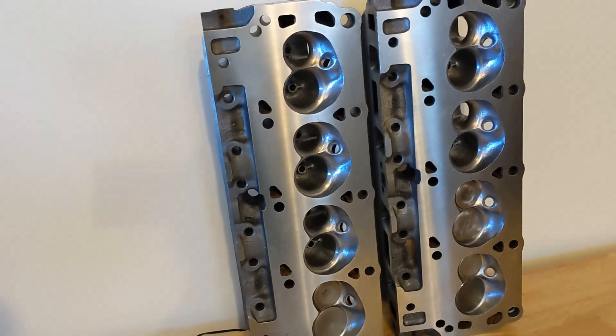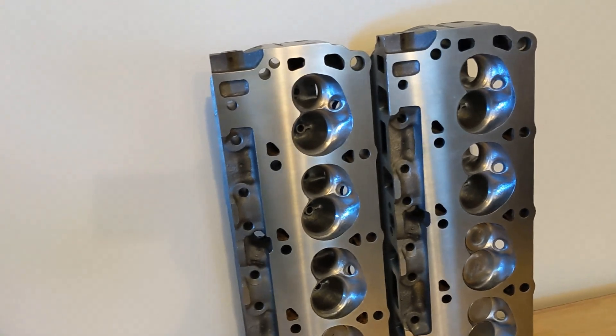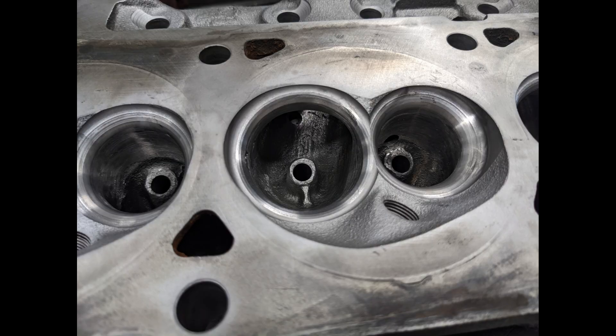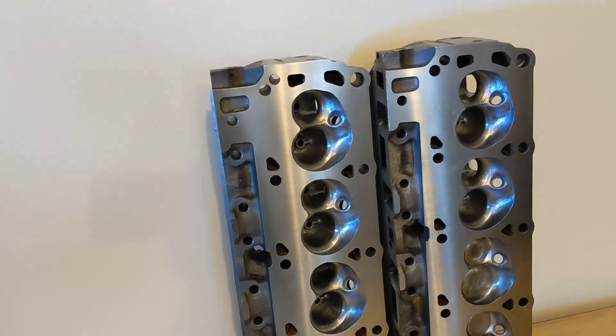The reason I want to work on these combustion chambers is to improve the airflow. As you can see in this picture, there's a lip in front of the intake and exhaust valves — I'm going to remove that lip. As well, on the shallow side of the combustion chamber along the edge there's a bit of a lip or overhang, and I'm going to lay that back. Additionally, I'm going to smooth the finish and polish it, and hopefully that improves airflow as well.